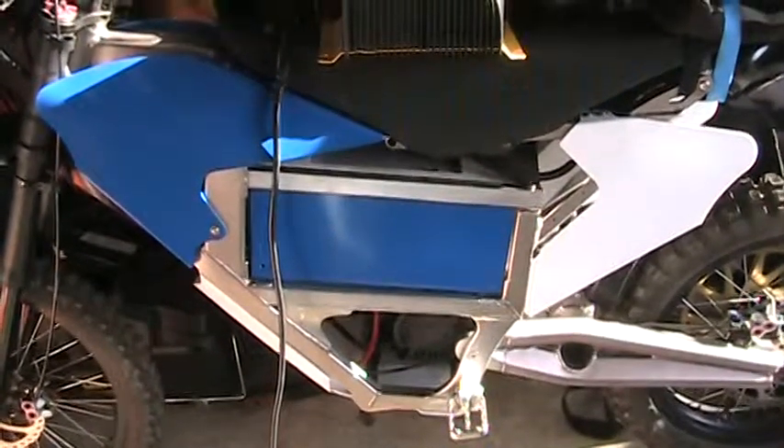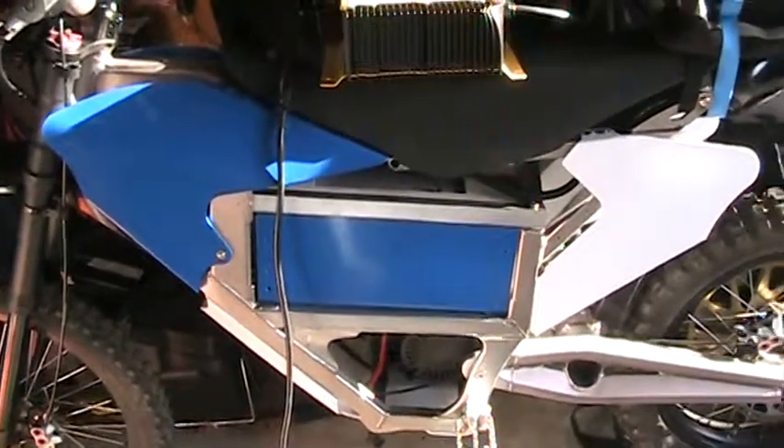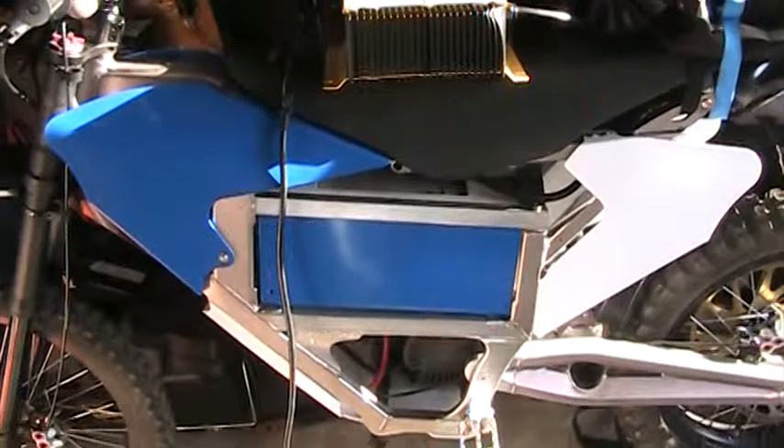You can go out and get Headways or Thunder Sky batteries and put your own packs together. Headways give you a 48-volt, 50-amp delivery with a 100-amp peak battery on my bicycle. You could easily put two of those inside of this box, wire it up in parallel, and have two separate chargers or just charge them one at a time, and replace this battery.